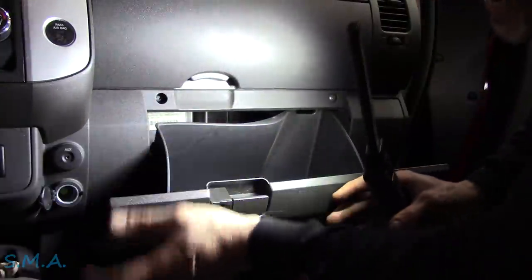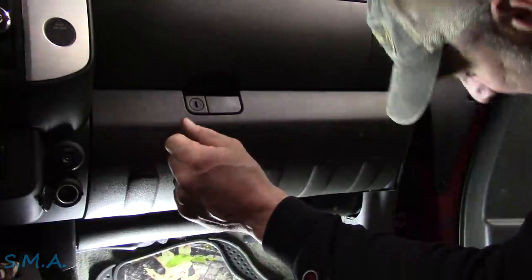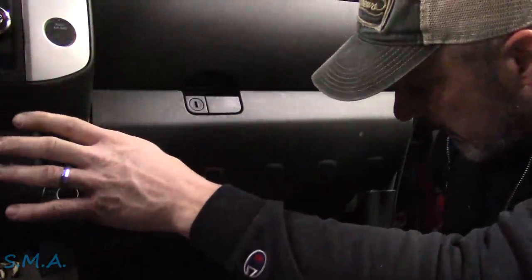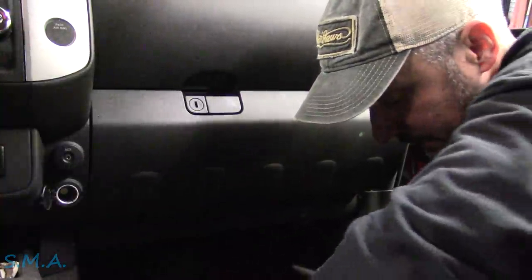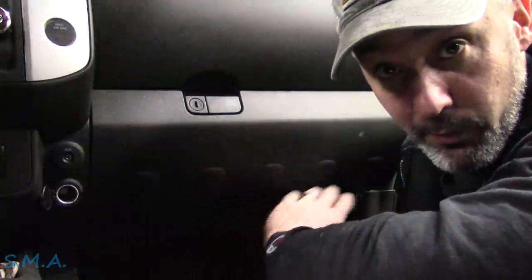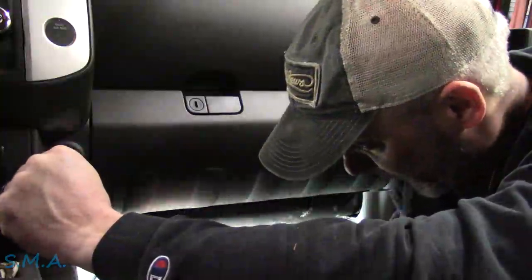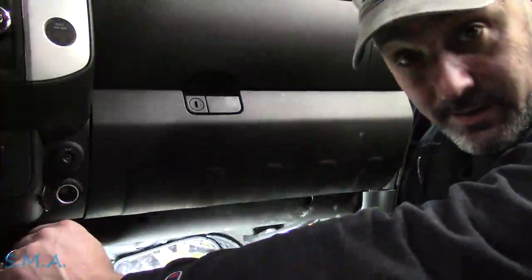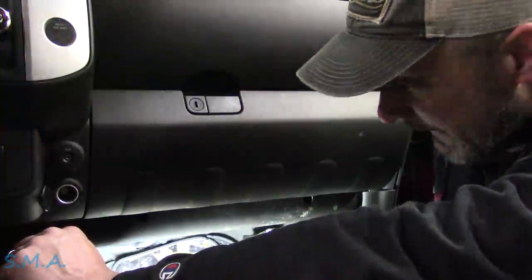We'll wait for the parts store to show up — they didn't have any, nor could they get any for today, which was disappointing. One thing I noticed: as I mentioned, it was unusual to have this style blower resistor on a non-climate-controlled system. When I looked it up through Napa, they showed with or without climate control. And this system takes the blower resistor for the one with automatic climate control, even though it does not have auto climate control. So I called Nissan, got the OEM number, crossed it to double-check. The Nissan guy confirmed it — it's got big cooling fins on it. And they both take the same connector, so it could potentially fool you.